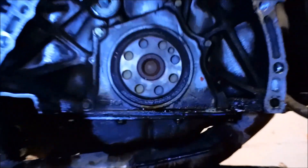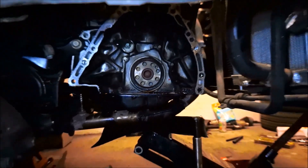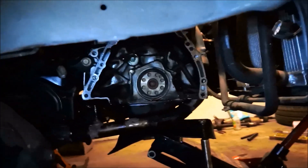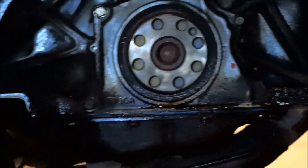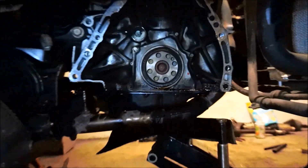So this is day one, and I have to quit right here — as you can see, the rear main seal is leaking. I can't hang the transmission, can't put the flywheel, pressure plate, clutch, anything on, until I hit up a parts store for that seal. So this is going to conclude this right here. It's already getting kind of long — so that's it for today.